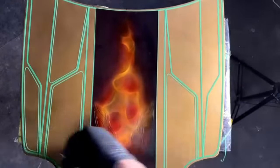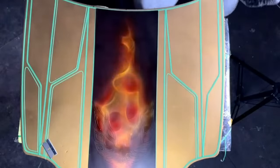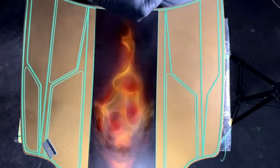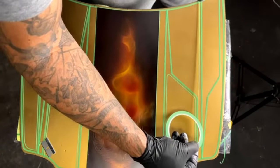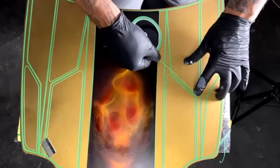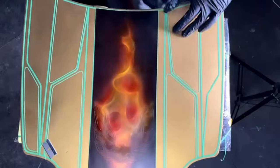John said, what's the difference between a primer and a sealer? A sealer is mostly going to be like an epoxy. It's meant to seal up the metal and basically keep it from corrosion. Then you can go straight to paint, or use a sandable primer, which will build up. It works differently and usually isn't as capable of taking care of corrosion issues, although it does help, but not like epoxy does. You can get away with just using the sandable urethane primer over top of bare metal. But if you want it to be bulletproof, the best thing to do would be to lay down that epoxy primer, and then if needed, lay down the sandable primer over top of that.